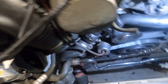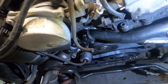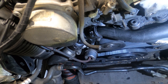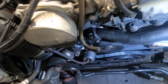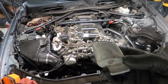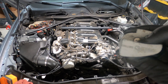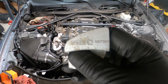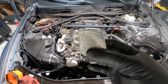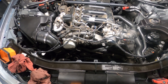I got the belt put on there, sitting on both the crank pulley and the AC compressor correctly. I was having a little bit of a struggle doing it the way I normally do — normally I have a car on a lift and I'm able to do all the work from underneath, but there's not enough room to do it from up top by yourself. If you had a second set of hands it probably would work, but since I'm by myself I actually used this tool. This is a stretch belt removal and install tool — it has an install side and a remove side. This is from Matco Tools, and I'll put a link in the description. I'll try to find a more readily accessible version of this as well. It really helps if you're doing this kind of stuff by yourself. Now that we've got all that done, we're just going to put everything back together and be done with this job.